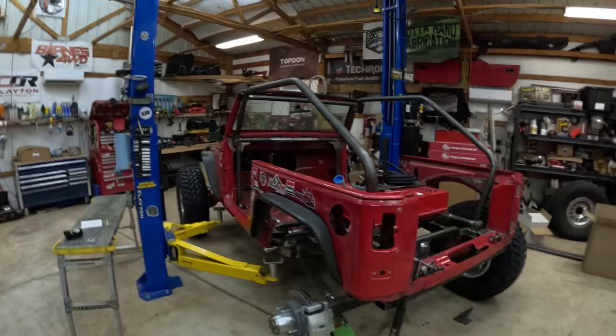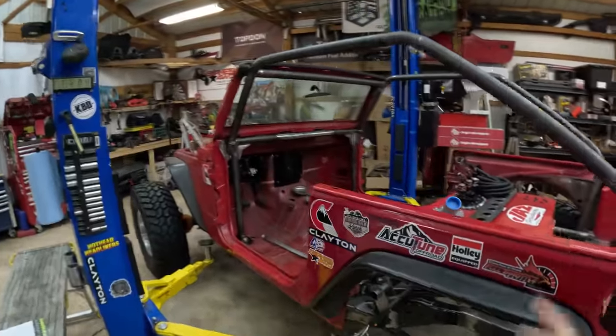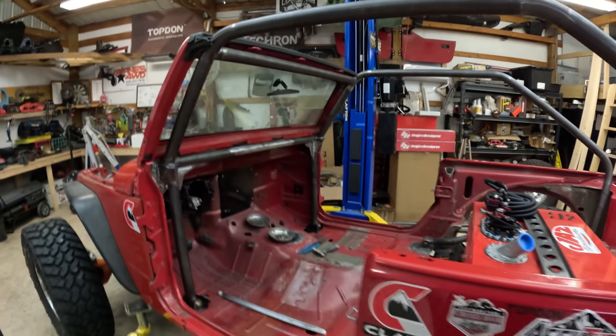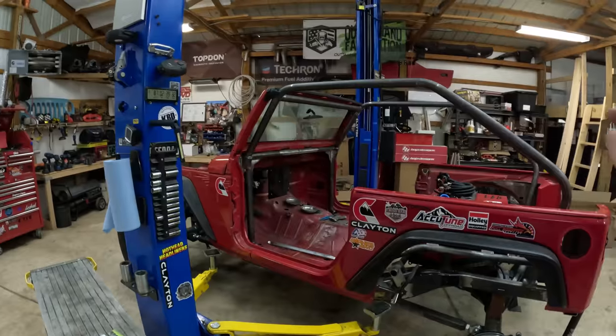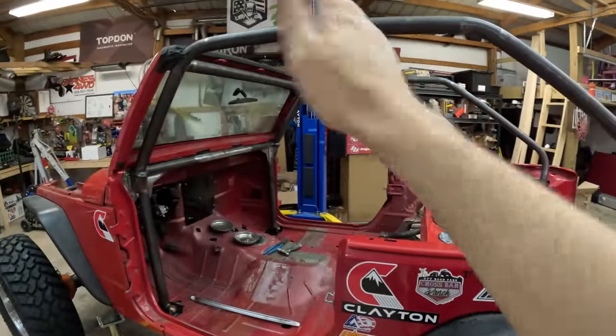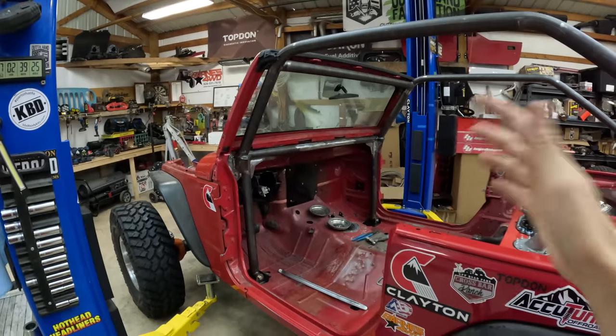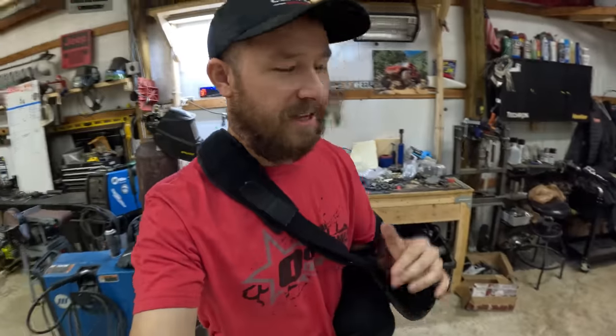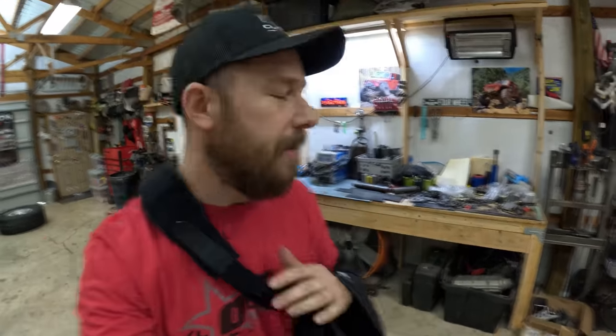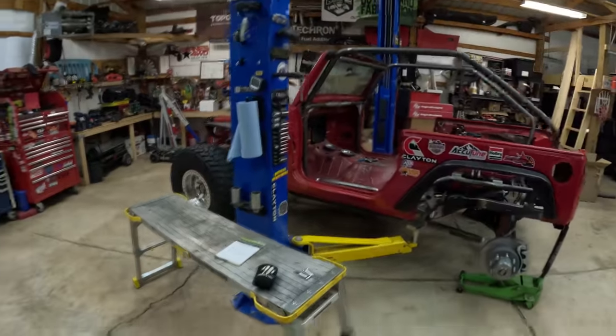I want to give a huge shout out to Mike and Dustin for putting in a ton of work. I just sat around and did whatever I could. This cage is looking phenomenal - beautiful welds by Dustin, Mike put in a ton of work doing all the notching. My main goal was getting this main framework done so we can start figuring out where we're going to put our B-pillar, all of the diagonal bracing, and the windshield V. The next video is when we'll hopefully dive in more on the technical side about notching and tube bending.